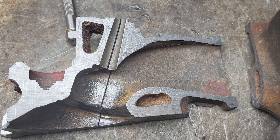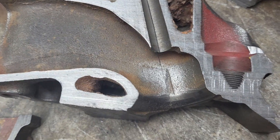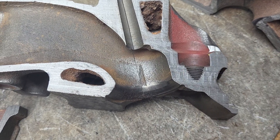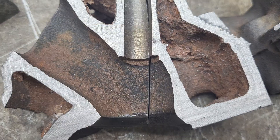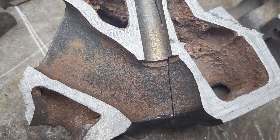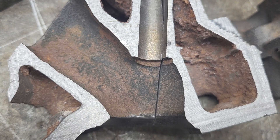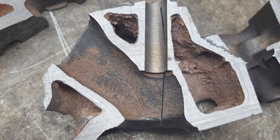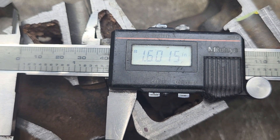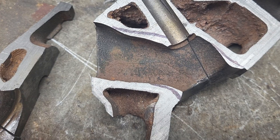Okay, we showed that already — that's our matching side which is the center of the cylinder. It is interesting how the bowl goes right to the plug boss. There's the piece I thought was missing — it wasn't missing, it was in the box. Now we can see our entire exhaust. Let's do a little magic marker action to show what this thing should look like — fairly close to 1.6, fairly even across where the valve seat would be.